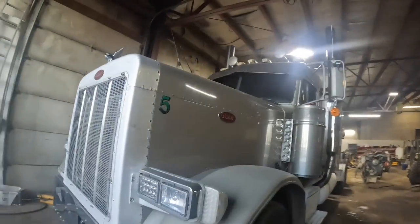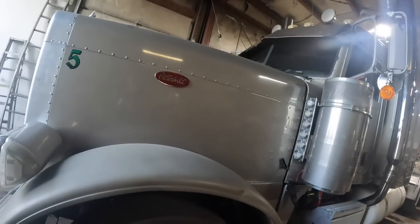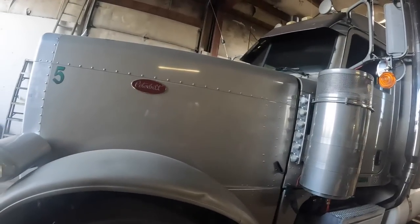So that's what we've got going on. What we're gonna do is get the hood back off, start pulling injectors out, and see if we can turn it over by hand to get the water off the top of the cylinder — number three.